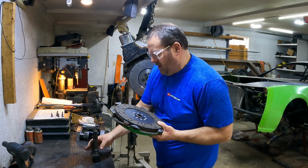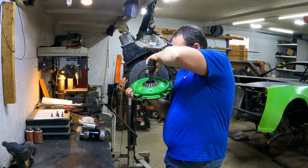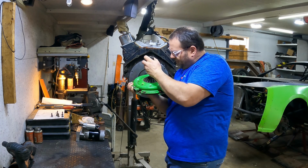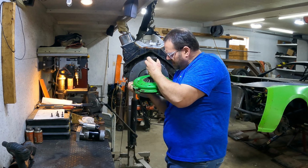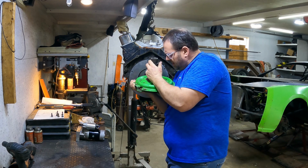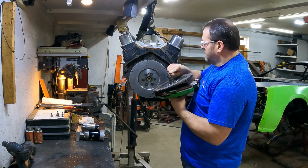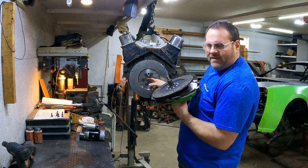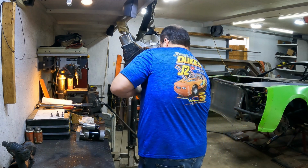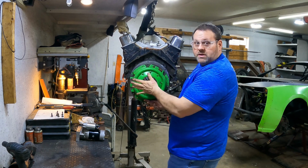And then we're going to turn this all over. We're going to stick the shaft into the splines. A little bit tricky, one of them needs three-hand type deals. And those splines are really, really tight. Okay, so I'm lined up, all right? So what we're going to do is stick this shaft into that spline, and that's going to get our clutch in the right place where they'll line up in the car. And so now I've got it up there, so it'll kind of hold everything.